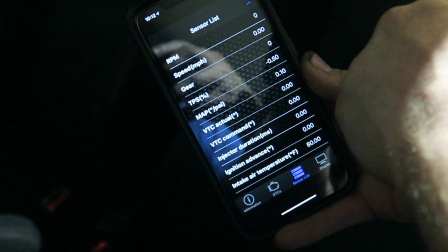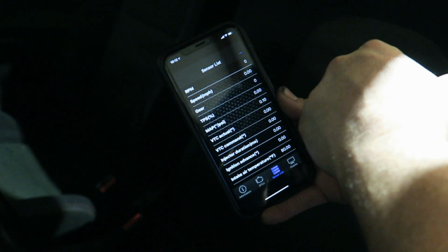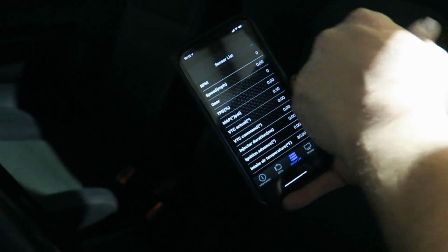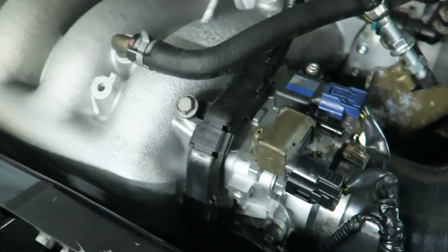No, that's good enough. All right, let me lock it snug it down. Didn't you? I just tightened it, with the idea that I was going to take it off, so it really needs to be snugged down. It'll come loose with vibration. So there you go. If you check it, your TPS voltage is right. If you don't check it, it's way off.